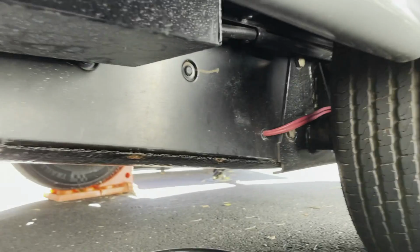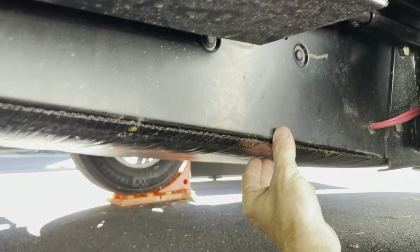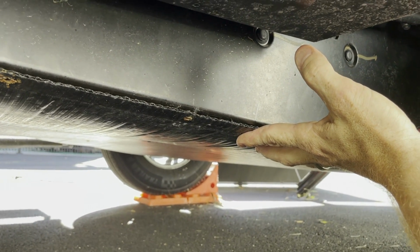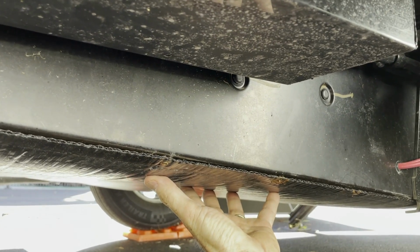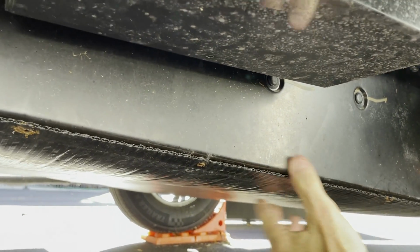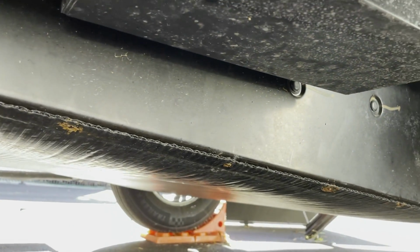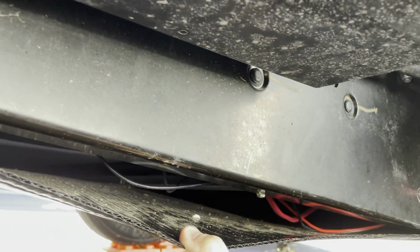Incidentally, if you have a Tab 320S and you're interested in running the wires through your trailer, I'll just point out what I did here. Underneath the tabs is a piece of corrugated plastic that keeps the mud and things like that from corroding or getting up underneath your chassis there. There are 4 screws that hold up this little metal piece that holds that corrugated plastic up there. I took that down by removing those screws. Then you can peel this back just a little bit.